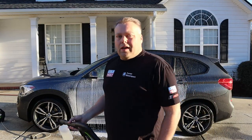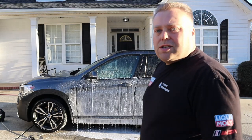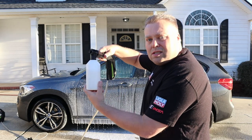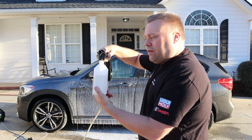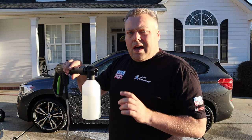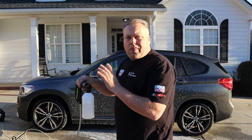That's pretty good — actually really good soap dispensing right there. Not foamy-foamy, but actually pretty good for like a pre-rinse. Just a really small bottle, and this unit likes to spin real easy so it'll just fall off if you're not careful. This is G-Technic W4 citrus foam, about 50 milliliters in here — it holds 500, so it's just a 10-to-1 dilution. In the 1000-milliliter ones I'd do about 100 to 120.